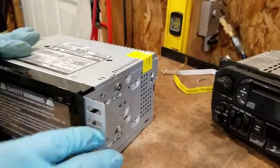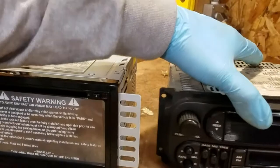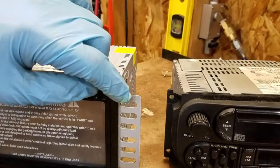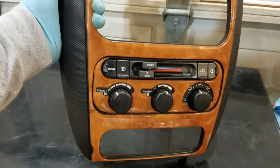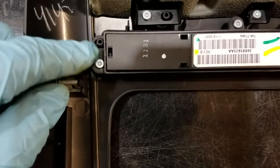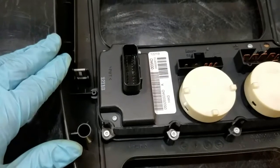I'll show you how it's going to go in. You can see these are the mounting holes here. I'm trying to mount mine the same way as the stock radio. I think I need to move the bracket down a little bit. I also need to remove the HVAC controls, the hazard controls, and the rear washer control. They come out with T10 star screws, and the reason is I'm actually going to modify the stock bezel to fit the new radio.